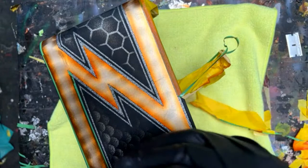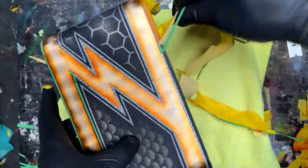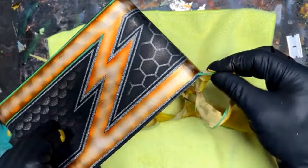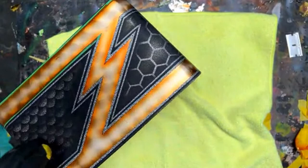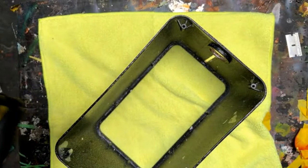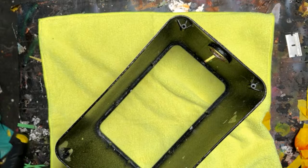Rather than doing it with 2K clear coat, because with regular clear coat, you mix it in and it's able to flatten out more on the surface. And to be honest, it's more durable because you're mixing your flake in a 2K clear coat that's chemically hardened. That's what 2K means, there's two parts to it. Now your flakes are suspended in a clear coat that's chemically hardened, rather than an inner coat clear or clear base coat that is basically like a jelly.